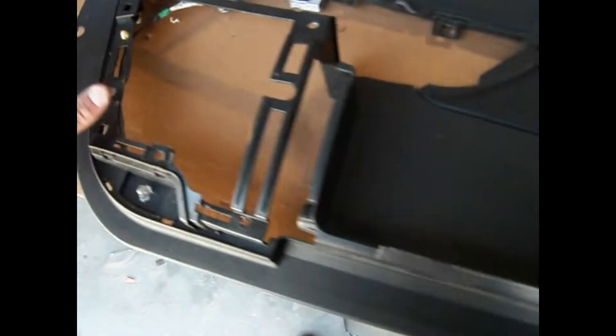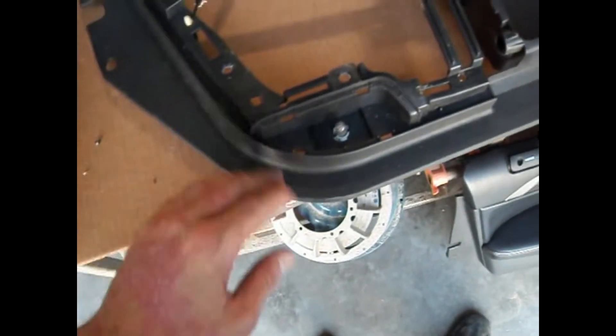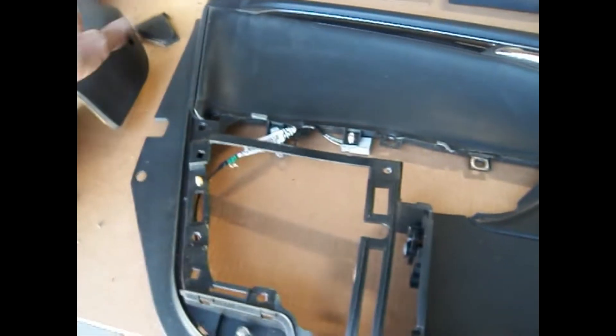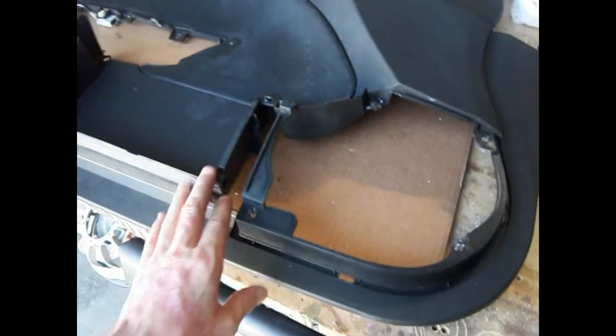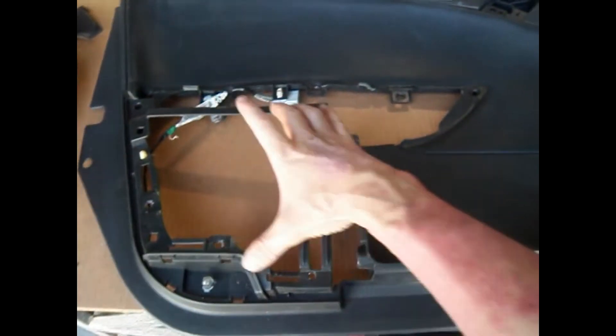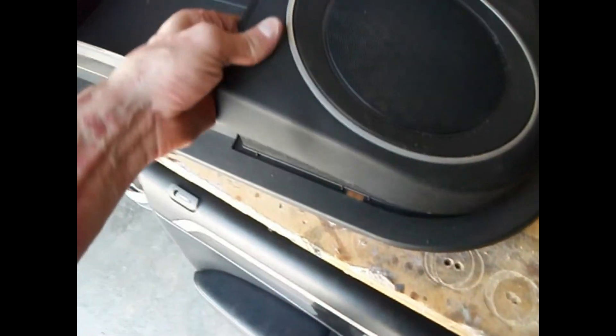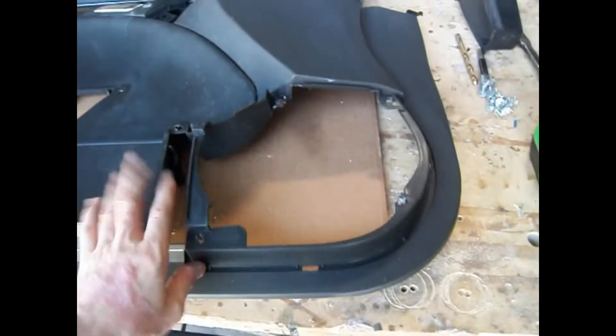In the shape of this door panel we're going to have to do some pretty intricate fiberglassing to build this thing. The idea is that I don't want to just lob off a whole section and pray we can somehow put it together and make it look good. What I'm actually going to do is only remove the portions that I need, which is basically the bulk of the center right here. All the center pieces are going to go. We're going to keep all the detail of the line edges going up and around right here, and including the line edges around here. The idea is that when we build the piece that goes down in here — the actual bucket itself — it'll fit right into those factory lines. You'll get a very factory look, and the overall look will be incredibly factory.